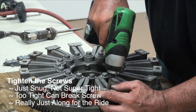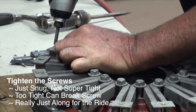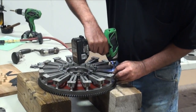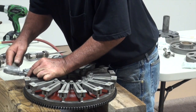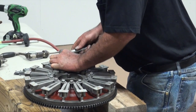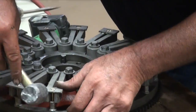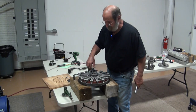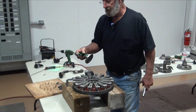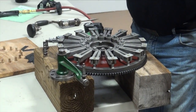Now I'm going to go ahead and tighten them down just a little bit more, run down my screws — not nut tight, just down snug, go all the way around. Then I'm going to take my little pecker and line these keepers up with the flywheel so none of them really stick out much further than any of the others. Magnets are kind of installed, everything's still loose, nothing's really tight.